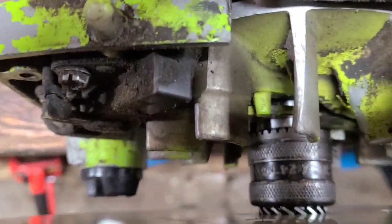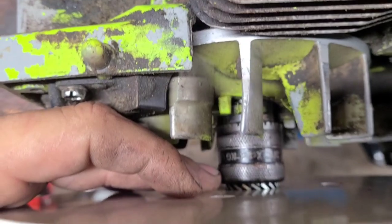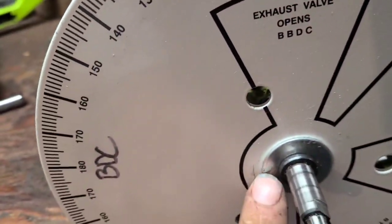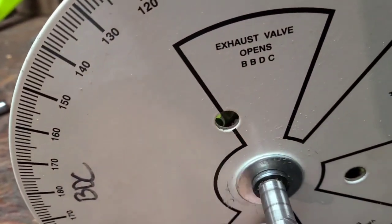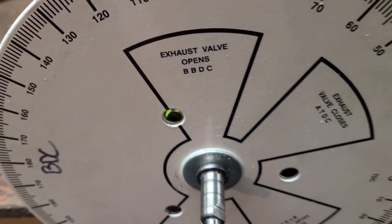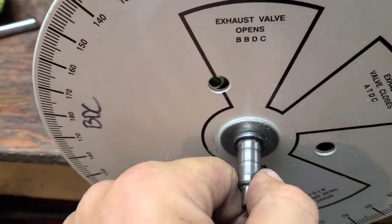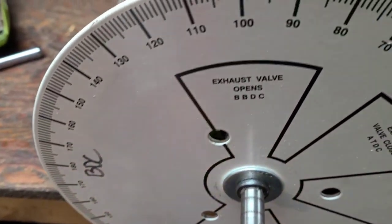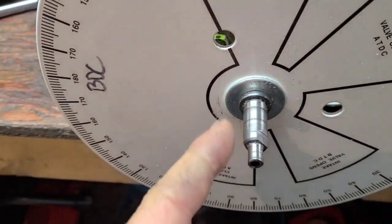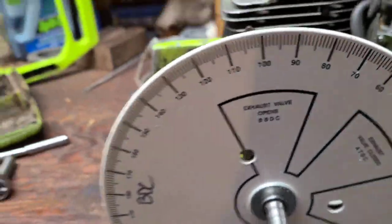Okay, drill chuck on the end of the crankshaft. I put this lock washer behind here. Then I took a file and filed a thick washer that takes up the gap in this timing wheel. And then this is just a threaded shaft that came out of the drill that this came from, and I just ground 2 flats on it. And that's how we do this.